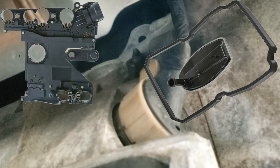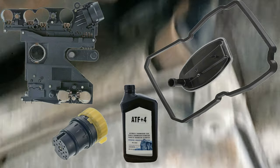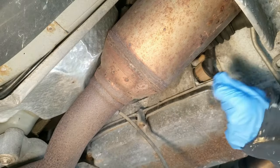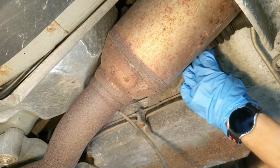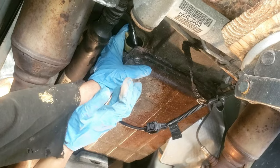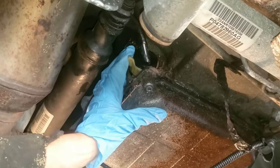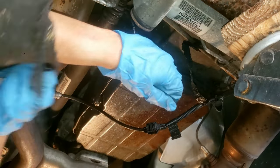This job requires a new conductor plate, but it's best to also get a new transmission filter, gasket, transmission oil, and plug connector adapter — all parts are in the description. I'll try to pull this by hand downward or counterclockwise. I have a separate detailed video showing other helpful tricks if you're struggling to remove this transmission plug adapter; that video will be in the description below.